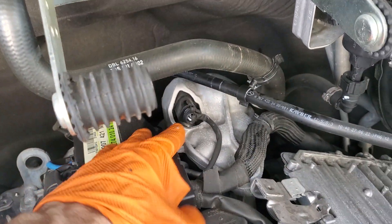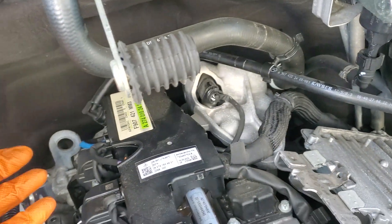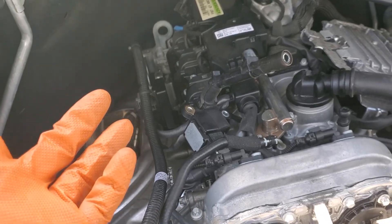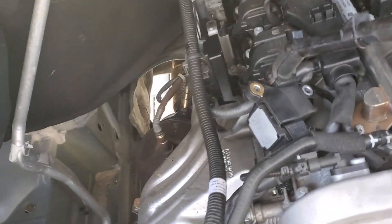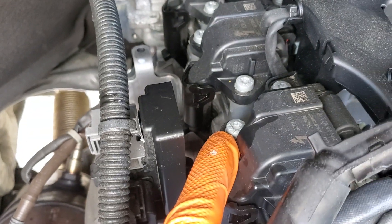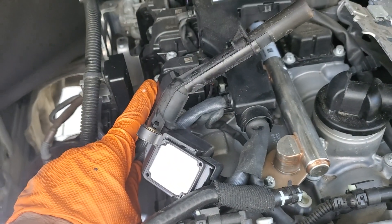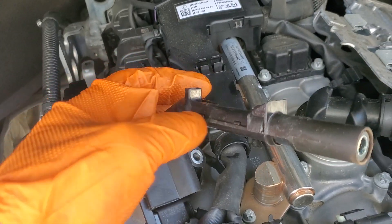The rubber cover — you've started prying it from the farthest corner, got that corner free, then just pry it gently all the way around slowly and she just lifts right off like a nice piece of wet bread. So I'm going to clean that up, and here's my first spark plug pull. It has two Torx tips — T-wrench or Torx — which you probably already have a set of. I don't remember the size but you'll figure it out. It's easy, and this coil came out quite easily.